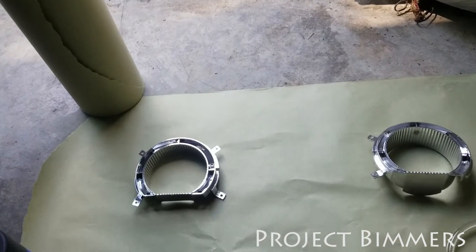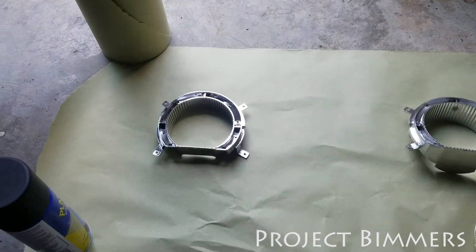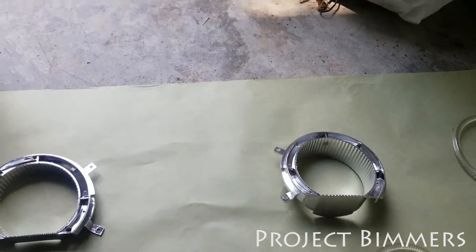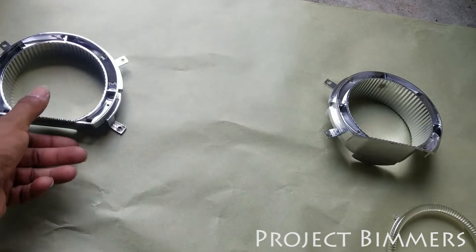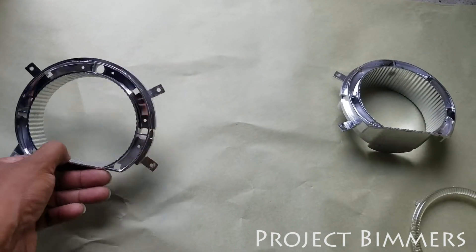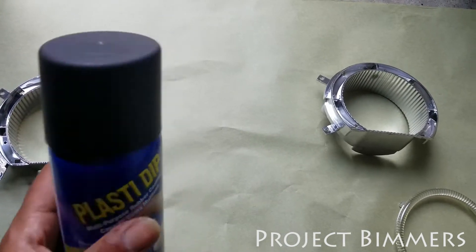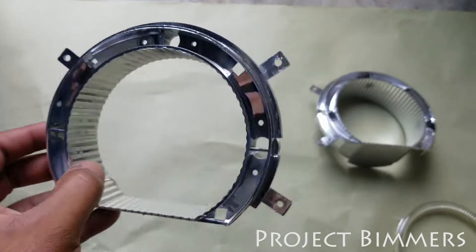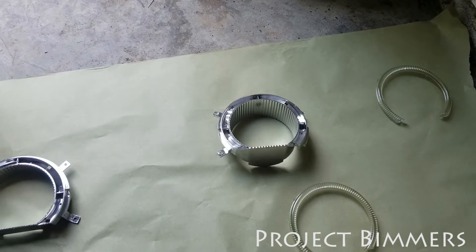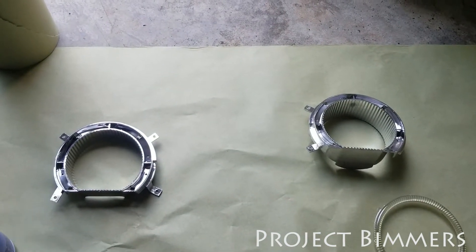I'm set up here. I'm not doing any major painting, so I'm not worried about overspray or dust. These pieces don't even have to be heavily prepped — it's going to be a very quick job. I'm going to use some Plasti-Dip to coat these plastic pieces in black. The reason I'm using Plasti-Dip is because paint is probably just going to start chipping off and peeling, whereas Plasti-Dip serves two purposes — it's a peelable substance, so once it dries on all those cracks, they'll actually be protected and it'll act as a seam seal so they won't start breaking. I'll do about five or six coats.